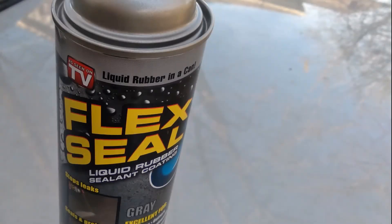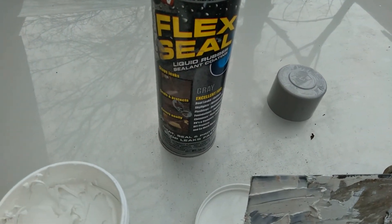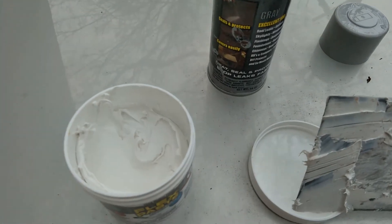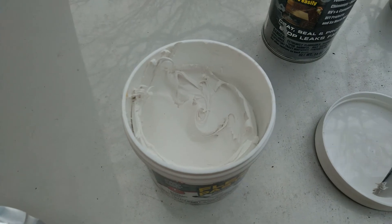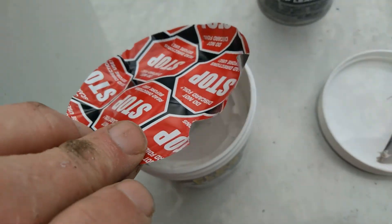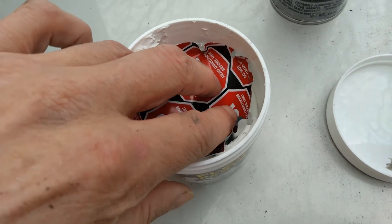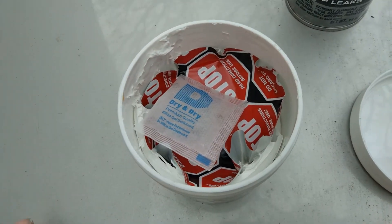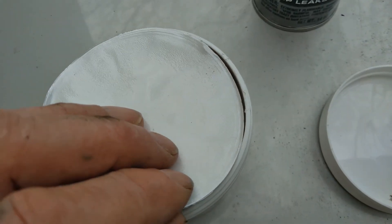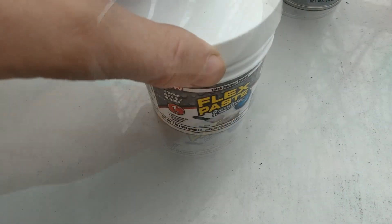So that's our second try at using Flex Seal to fix the leaky gas tank — let's see how this goes. So far in this video series we've gone through an entire can of the gray Flex Seal spray, got two good coats down on the gas tank. Used maybe a third of the tub of the paste. When it comes to the paste, oxygen and humidity are your big enemies — you want to make sure you don't throw this away because you're going to use it again. Press it back in, work out any air bubbles, don't stir it up. Put it all back in; if you're lucky you'll get a second and third use out of it.